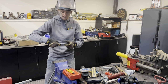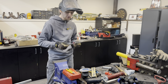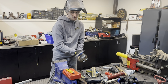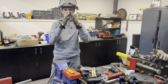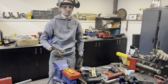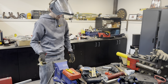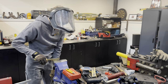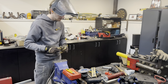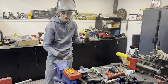I put a bevel along the top of this piece — I realized I did a little too sharp on one side — but I put a bevel on it because I'm also going to put a bevel on this one. That means my weld will get better penetration, because then you'll have two points meeting and you get good fill on either side as it goes down. I'm not a professional welder, so don't take my word for it — it's just from experience that usually gives me stronger welds. Now I'm going to bevel this piece too, and now it's all beveled up. I'm just going to grind the coating off a little on this one to make sure I have good contact points.